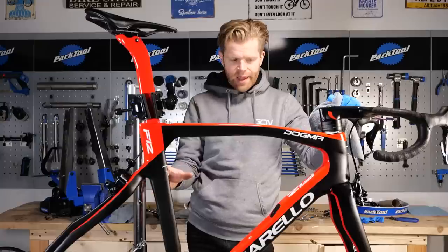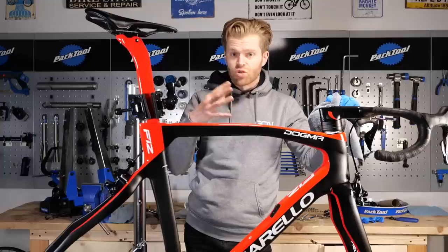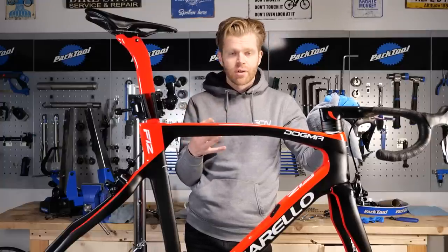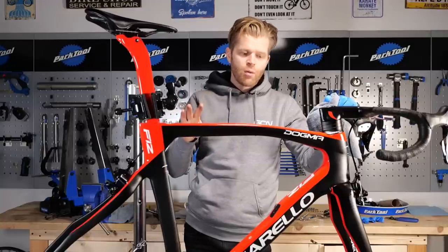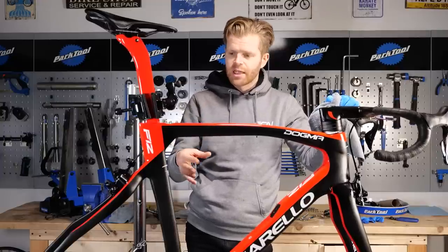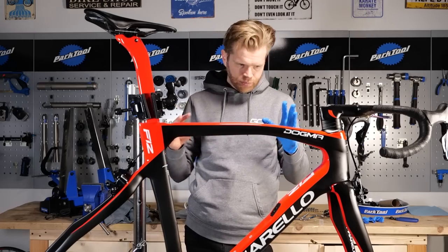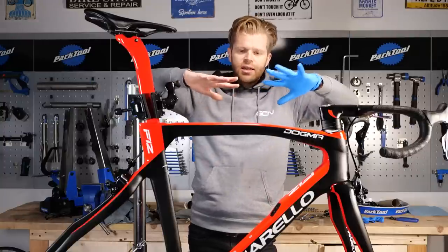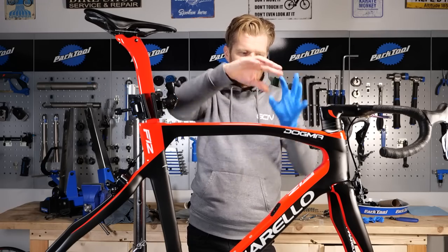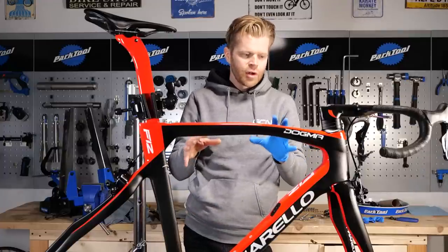Now, with this coat on there, what you then do is leave it 24 hours to dry and cure. Following that 24 hours, you could take your bike out and ride it, but you can't jet wash it or wash it for a further 7 days is the advice on this particular ceramic coat. That's because there's a cross-linking reaction going on. The ceramic coat is made of siloxanes, and what they're doing is performing a silanization reaction where they all cross-link together, and that strengthens and hardens the ceramic coat over the entire surface. So that curing process is really important.